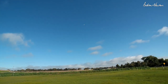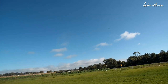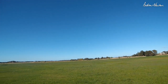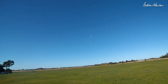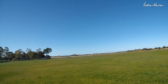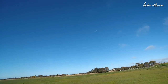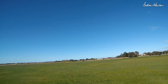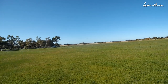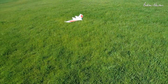I think it was drawing 18 amps at full speed, so no dramas. Full speed — woohoo! That is quick. Yeah, it's a speedy fella. Nice and efficient. It would be a good fast FPV wing I think. Gets a bit wiggly in the side wind which you'd expect. Having to hold forward pressure a little bit. Very good, that's nice.